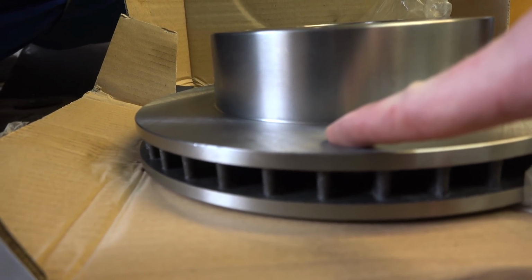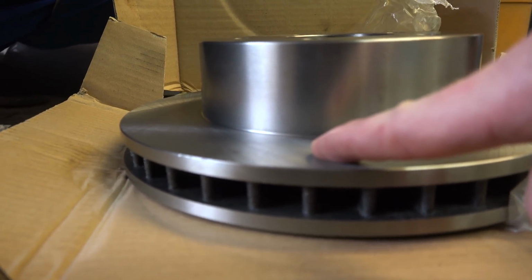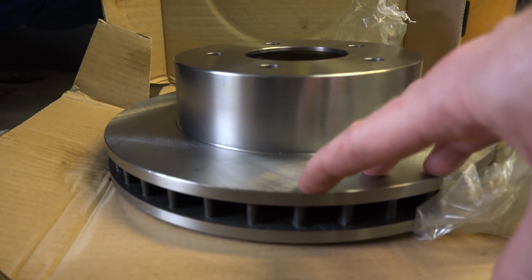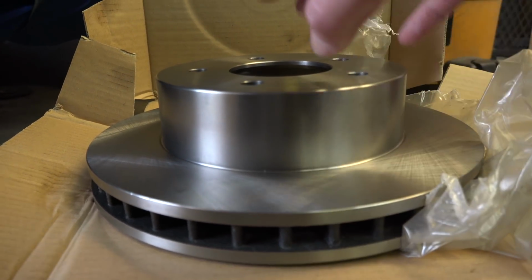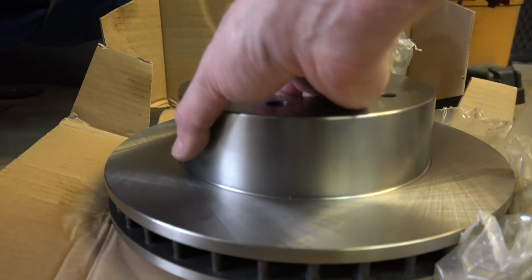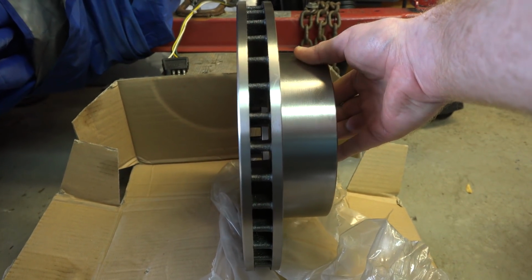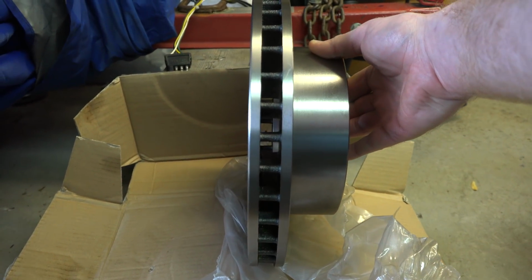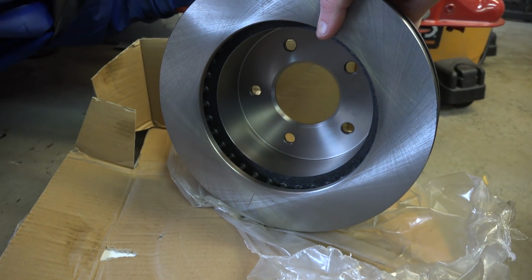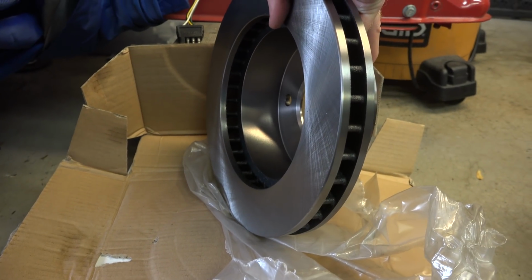Like I was saying before, the rotor thickness matters. There was a 1-inch rotor available, and your calipers may be set up for that. This is the 1.25", so that's what I have to find to work with the rear. It's also got that proper 5x5 bolt spacing. This will mount over the bracket, give enough depth for everything to fit, give enough caliper clearance, and again with the bracket that I'll show you in a second, will fit over my axle tabs and allow me to go rear disc in the back of this C10 on a 12-bolt rear end.